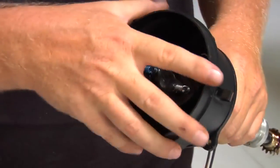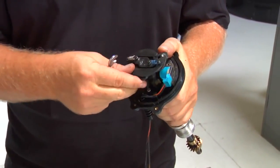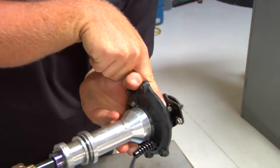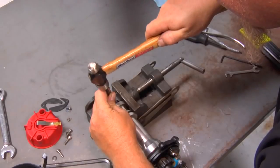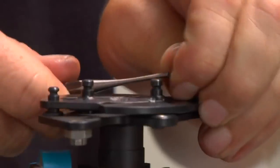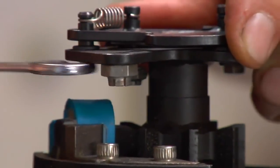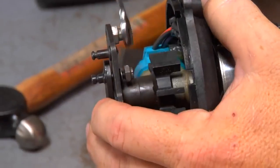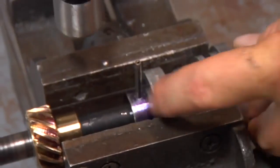This particular distributor has a cap adapter setup on it. In order to remove the weights that work the advance mechanism and the springs, you first need to remove this little tiny nut right here. You're going to need to remove the collar off the distributor shaft. Once the collar is removed you can pull the shaft out of the housing a few inches. Go ahead and remove the weights and springs, and on this MSD distributor remove the nut that controls the advanced stop bushing. Rotate the shaft 180 degrees and position the stop stud in the other hole. Use the same nut to lock out the advanced mechanism. Slide the shaft back in place, reinstall the collar, and you're all done.